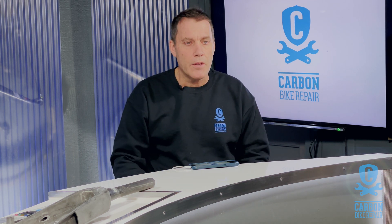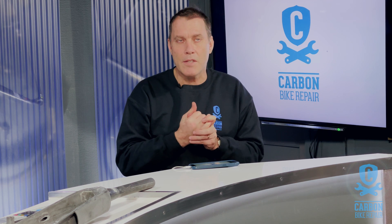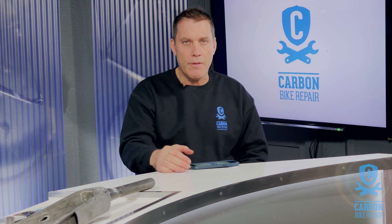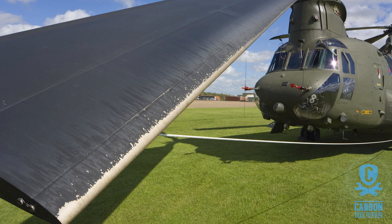But on bicycles it seems to have developed into this process where people feel that tap testing is the way forward — when it is not. If you look here at a blade of a helicopter, this is a very long piece of material which won't change much in thickness, except maybe the structural ribs that run through the blade. In most cases it will be very consistent in its sound, and if there is an inconsistency, generally that's a sign of rivets that have come loose — they get a kind of hollow sound.